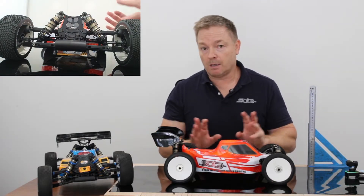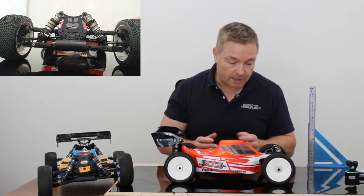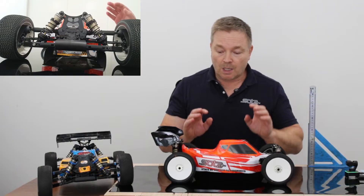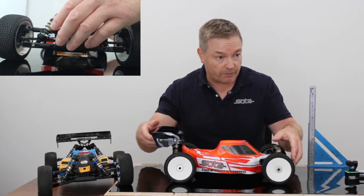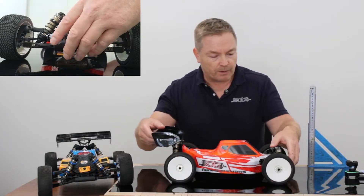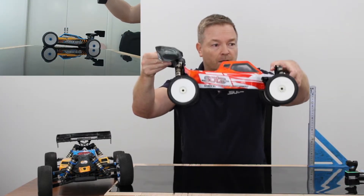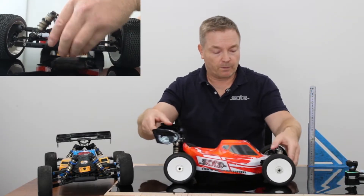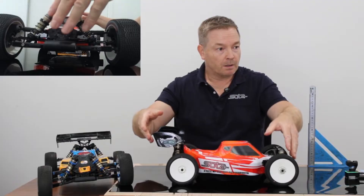These are absolutely must-haves on all of the large Baja type races, king of the hammers, rally cars — position-sensitive is what it's all about in off-road vehicles. It's now available here again, and it's tunable. With the 5x1.5s all corners under traditional pistons we had about 30 millimetres. We'll start from there, and you can see straight up we've got nice supple suspension.